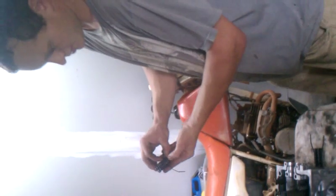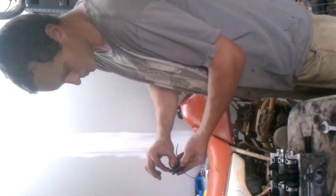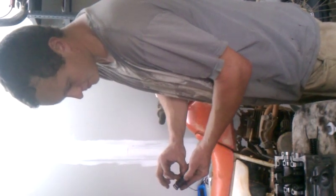Where there are tighter coils and there are looser coils — the looser coils go to the retainer clip, the tighter coils go to the bottom, because this end is heavier, which makes your valve turn lighter.